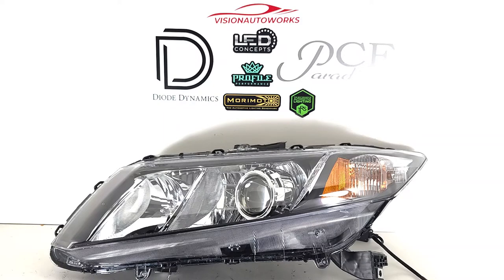We used two and a half inch bi-LED projectors inside, and we used the mini Gatling gun shrouds for best fitment on these skinny lights. We're gonna cut them on just to give you an idea of what it looks like lit up.